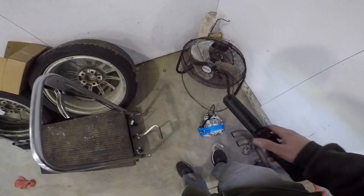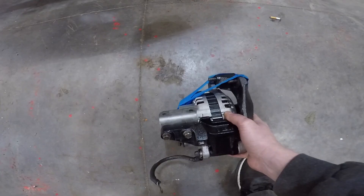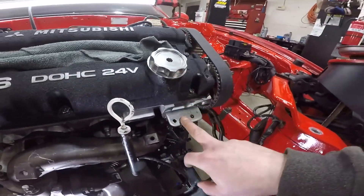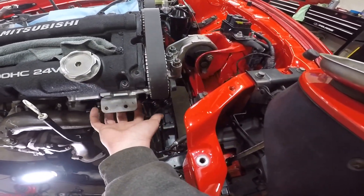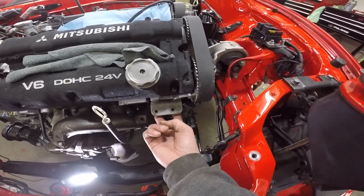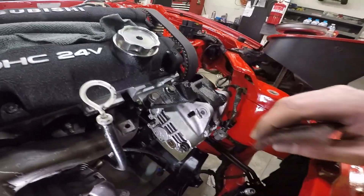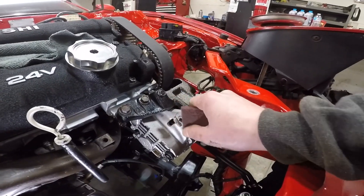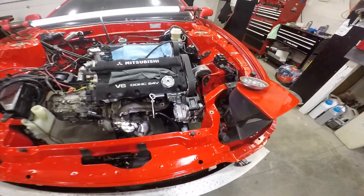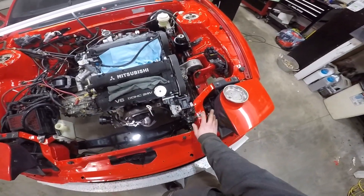Bracket and the alternator — it's gonna be easier to do that before you put your other pulleys on, and you definitely can't get the bracket and alternator out with the radiator in. It'll go on kind of at an angle and bolt into those two holes and then two over here. Got that bracket on the heads. Probably start these ones first because you don't want all the weight just hanging on your head. Also, you should put a ground from here to there — just clean this off, make sure it's good for a solid ground connection. This car has a grounding problem; I'm sure most of you guys know about it. There's like five extra grounds you should put on this.